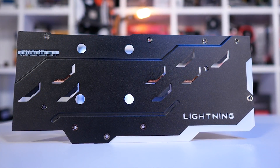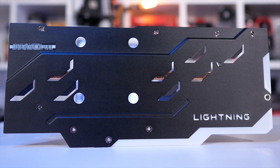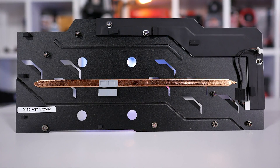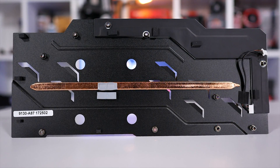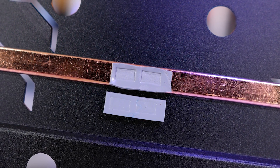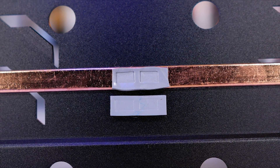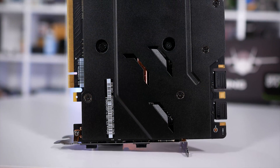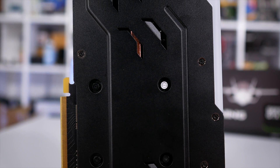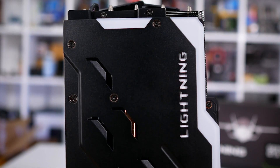Off with the back plate first. The back plate on the Lightning Z actually looks very impressive — I like the cutout vents, the Lightning branding with the RGB backlighting, and the copper heat pipe poking through those few vents. Once off, we can see the backside of the plate, which features a flat copper heat pipe running from end to end. Towards the middle there's a pair of thermal pads, just one of them on the heat pipe, located over the backside of the GPU to extract built-up heat from the PCB. The copper heat pipe then disperses this heat across the back plate. I'm keen to run the card with and without the back plate to see what kind of difference it makes.